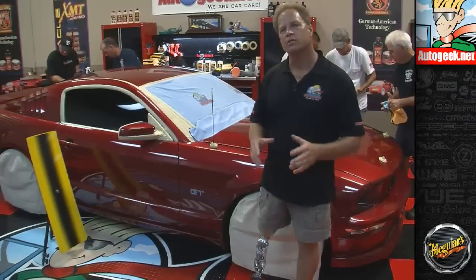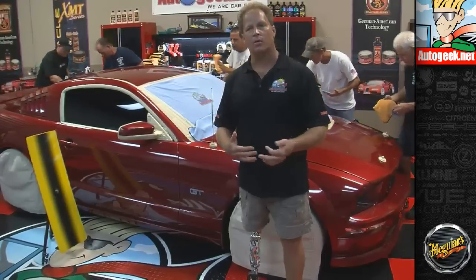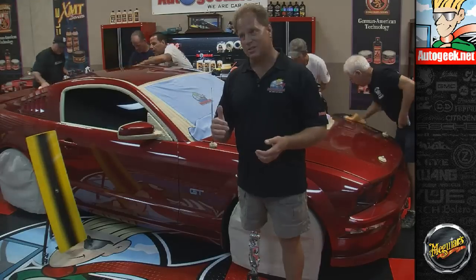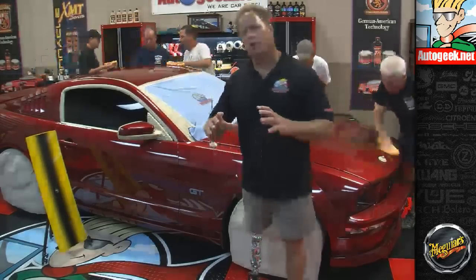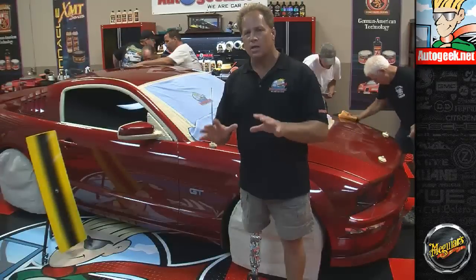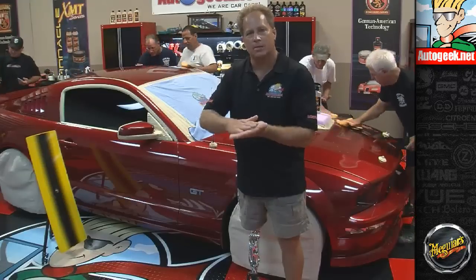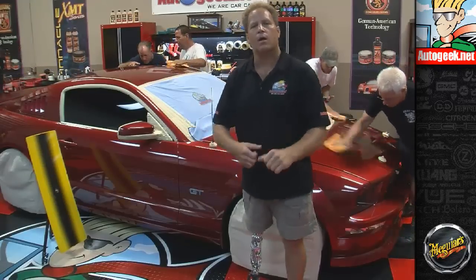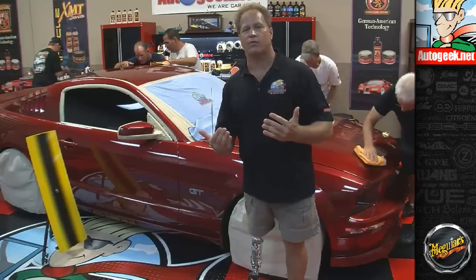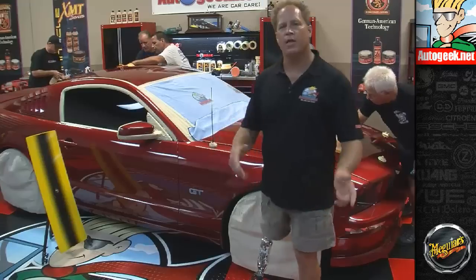And the other reason is anytime you're using foam pads on tools like the Porter Cable, the Meguiar's G110 V2, or the Griot's Garage 6-inch random orbital polisher, which are all basically what we call a DA polisher, a lot of times they'll just glide over the contaminants. They won't really kick them off like a wool pad on a rotary buffer would do. So what I always say in the forum is the most effective way to remove above surface contaminants is to clay it first, then get with the machine polishing.